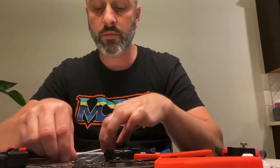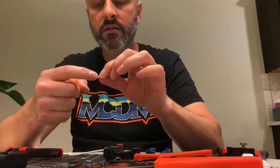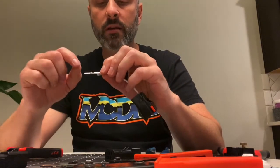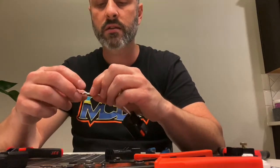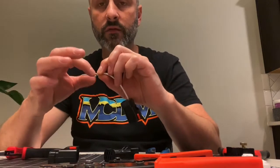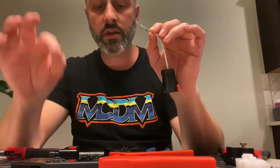The other thing is, once you crimp it, imagine I've crimped this — I have the open end here, and then there's the flat area. I put it on my wire and I crimp it. You want a good crimp that aligns everything up well, and you don't want to distort the back where it clamps onto the housing. The smaller tabs clamp on the housing. You want it to be fairly flat because it'll mess up the alignment — it won't seat correctly if everything is over-crimped or distorted. So you want good crimpers. Those are available at HughesHandbuilt.com for $29.50 — worth every penny. I can't recommend those enough.